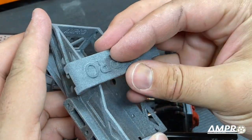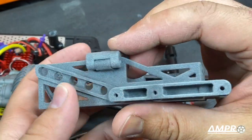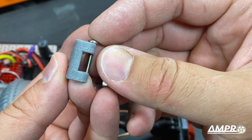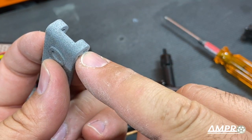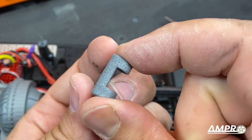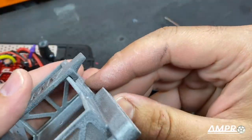Once that is off, you'll see that it's going to mount just like that. To mount this, we need to get a screw. This side here you'll tap with an M3 screw, and you'll want to thread the screw in like this. This side here is not tapped — this is a 3.15 millimeter hole — because the point is you just want the screw there as a pin, probably a longer one, and not to actually pinch these shut. To latch it, you'll just push straight down, and there you go.